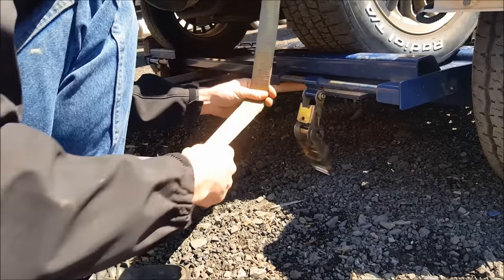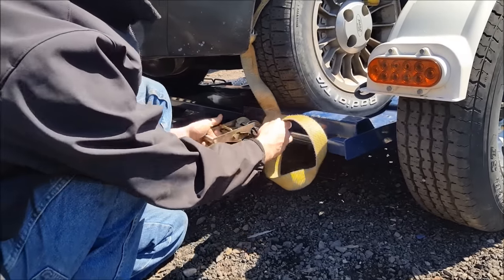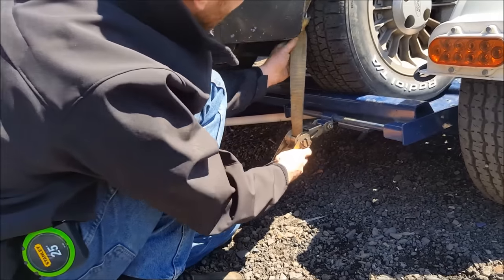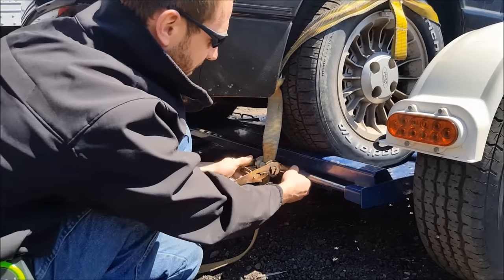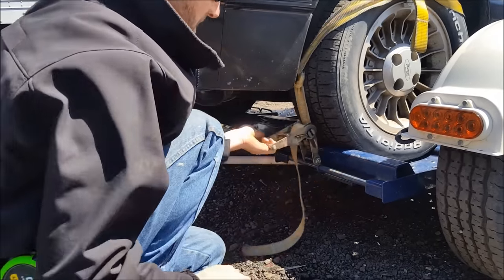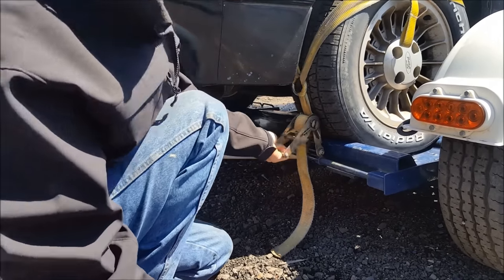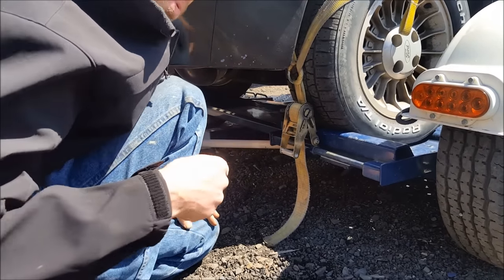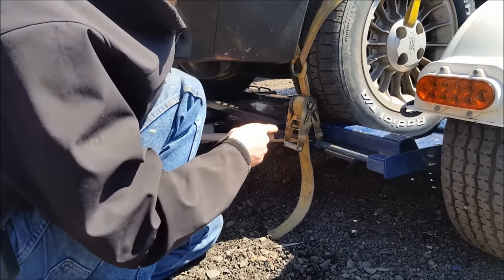Go ahead and put it in the ratcheting position. You're going to want to line this groove up here and slide this through. Make sure you've got no twists or kinks — leave some slack here. You want to get at least two or three winds on here so it doesn't slip when you're in tow. Tighten that down nice and good. And once you get both sides down, take it for a couple turns, maybe the first mile or so, get out and definitely re-tighten these because they're going to loosen up — they're going to seat into the tires.